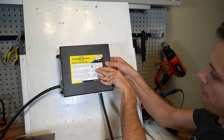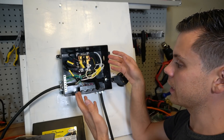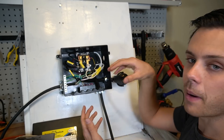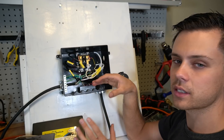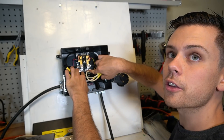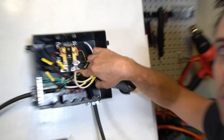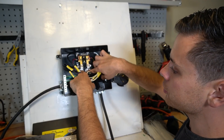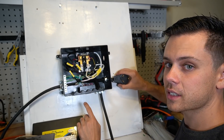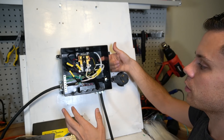If you have a progressive dynamics lithium iron phosphate battery charger, connect it directly to the ATS so that you bypass the built-in converter charger entirely. When you get shore power, where do you want the battery charger connected? Connect it to the shore power side. On the bottom terminal, there are two small screws — terminate your battery charger at those screws and at the grounding block. That way, whenever you plug in to shore power, it will start charging your house batteries.